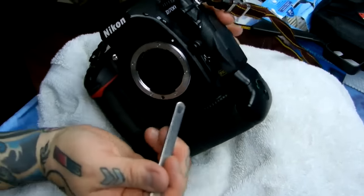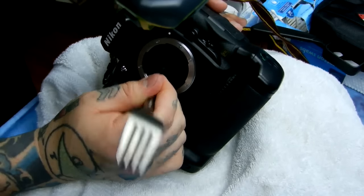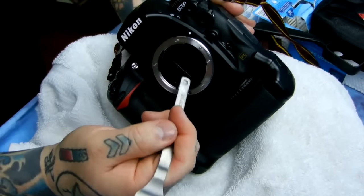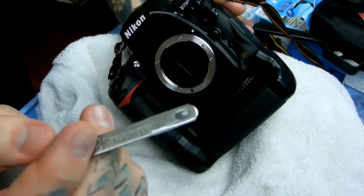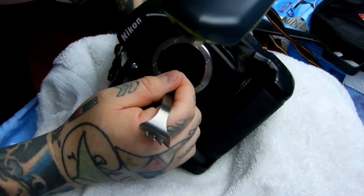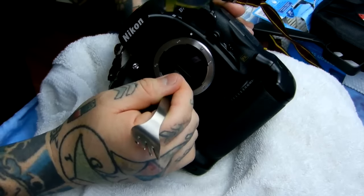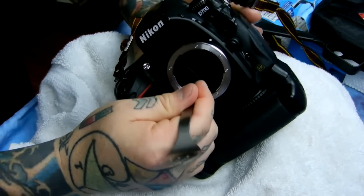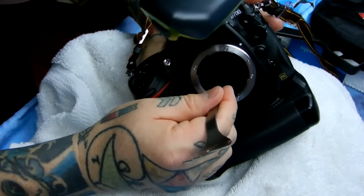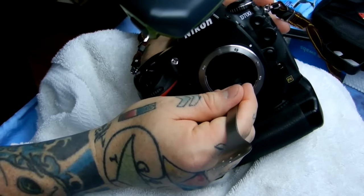There's another wall over here, and I've got a bunch of lint — I'm going to remove it right here. You may have to repeat this step. I just got a big one. You might have to repeat this step a few times with the tape. All I'm doing is using this sticky tape, which does not leave a residue, to remove these little errant hairs. Be careful — I'm not going near the autofocus sensor bay back here or touching the sensor.